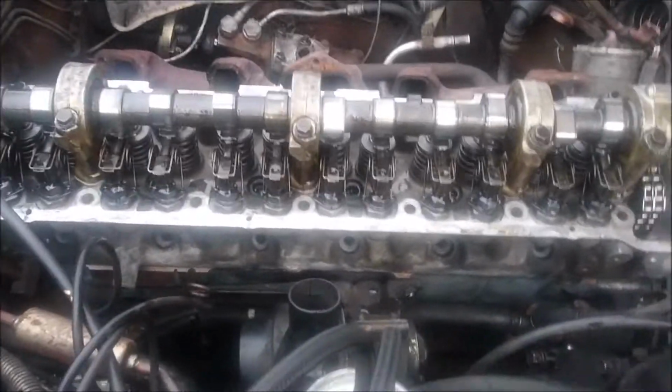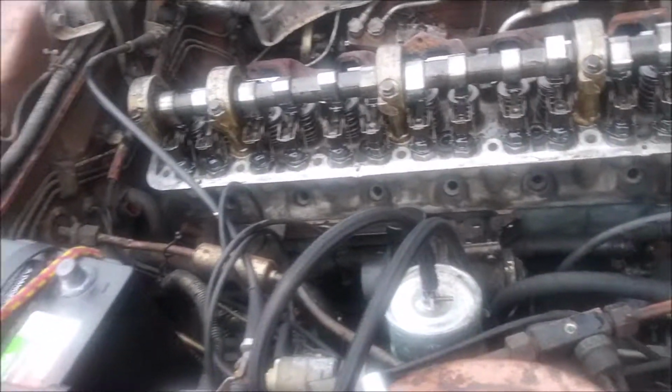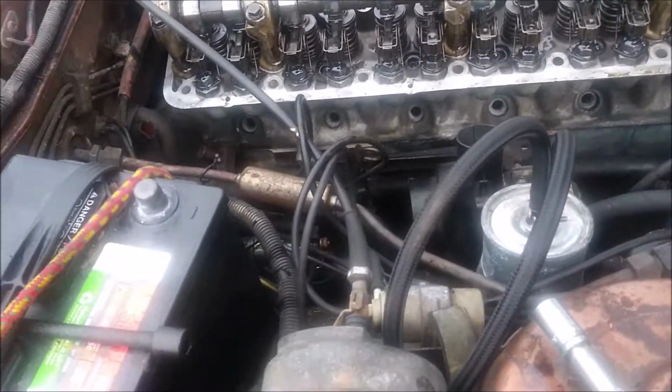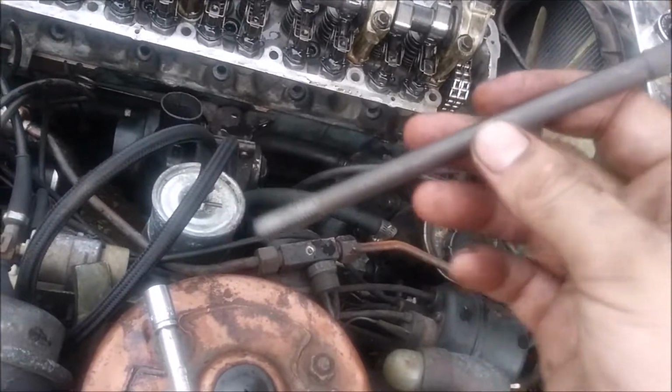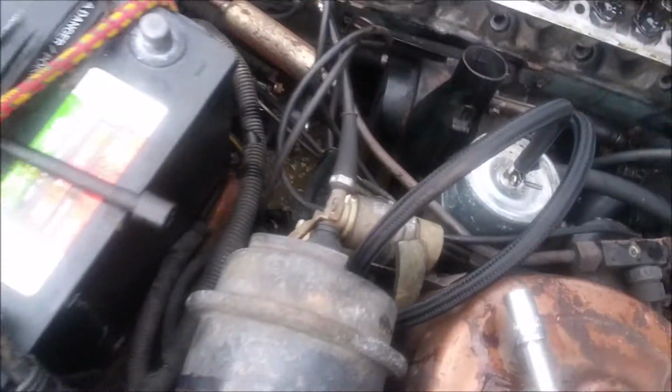Anyway, it definitely loosened up once I got the oil. Anyway, I'm going to go ahead and torque down the head. I got all the bolts here. It came from the Z store, I think. You get a set of long bolts, which are the ones that go into the cam towers, and the short bolts are the regular ones.